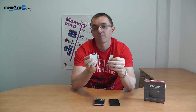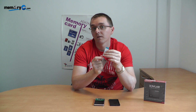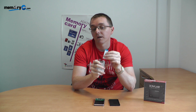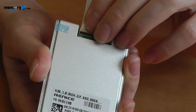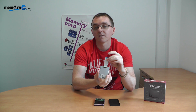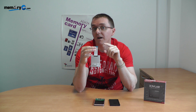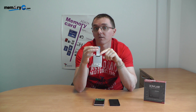If I do it this way, I'm doing it wrong. I must take the thin end — the plastic backing is visible to myself at all times — contacts straight down. I'm going to plug the cable in, pushing it down on both sides to make sure there's full contact. Now if I push down the lever, I'm making a full tight seal. I can hold the SSD like this. I don't recommend doing what I'm doing — this is purely to demonstrate the fact that the connector is strong enough to hold the product itself.